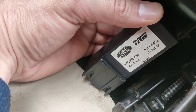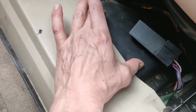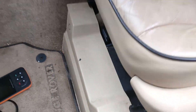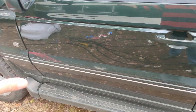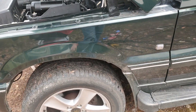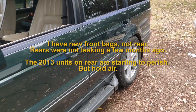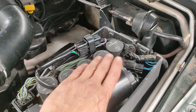That stays up so long as I remove ANR4652 — the control unit box underneath this plastic. This is a relay controller for all that. But if it's playing up, when you close your doors after turning the car off and it's not working properly, it actually drops the whole car straight down to the bump stops. I had recently fixed all my air suspension problems with new bags, so that's not the reason it's dropping. The reason has nothing to do with an air leak from the actual bags, and I did a soap test — there were no leaks.